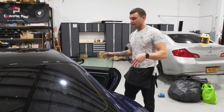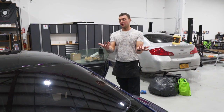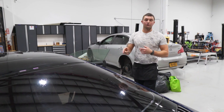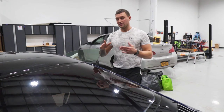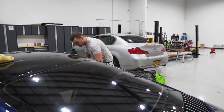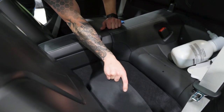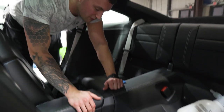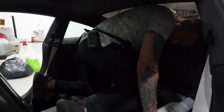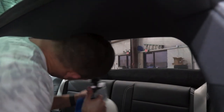With this back window I am going to frankenstein it — I would not recommend it unless you're very flexible and able to do the acrobatics needed to get into the back window while holding the film. Otherwise you can reverse roll it, but this is the frankenstein method. Let's get inside, prep the back window, grab the material, and slap it on. A little tip: these floor mats — no matter what kind of vehicle — I always flip them over just in case I step on them so I don't put a footprint in them. For reference, I'm about six foot two.